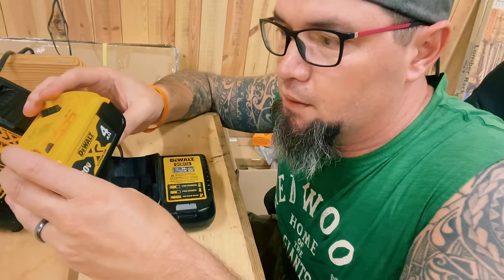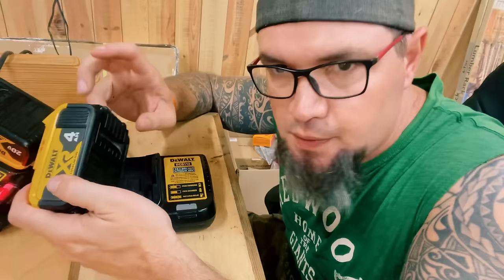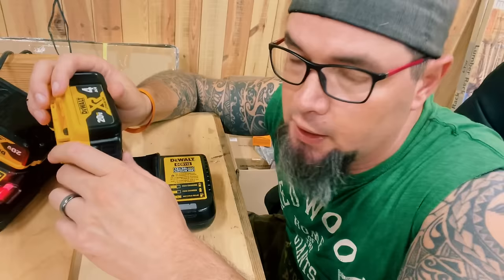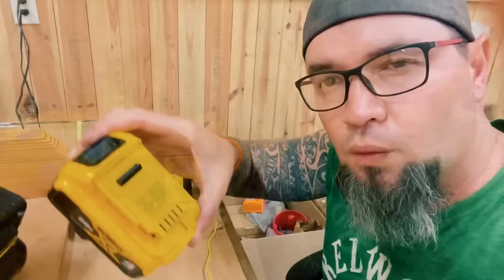This is actually a fairly new lithium-ion DeWalt battery that was left on a radio or something like that and was completely depleted. Sometimes with these lithium ions, whenever they're completely depleted, they have to be reset in order for them to take charge. It's kind of like a golf cart — if you run it completely out without charging for several days, you have to take out each cell and charge them individually. So we need to get a little bit of juice in here in order for the charger to pick up and actually start charging.